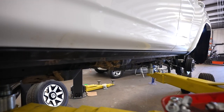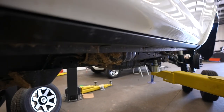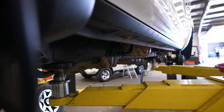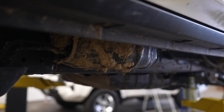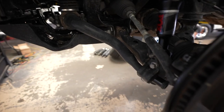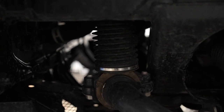So this is how to tell if you do or do not have KDSS. If you look right under your driver's side door, there will be a module box that is attached to the frame — this here is your KDSS brain. You'll have lines running to the front and the back of it. Another way to tell is if you look down at your sway bar, which is this thick bar that runs from one axle to the other — it will be a lot thicker.